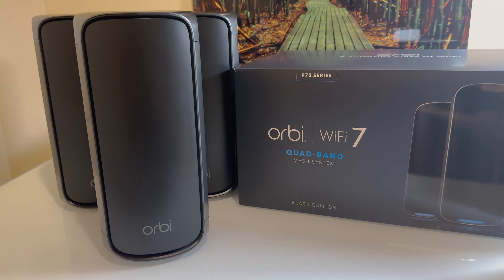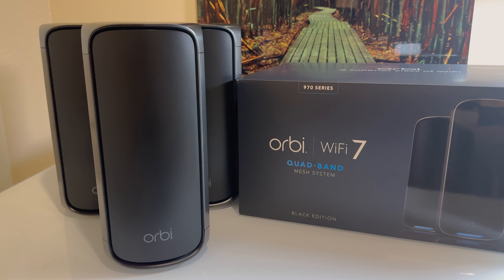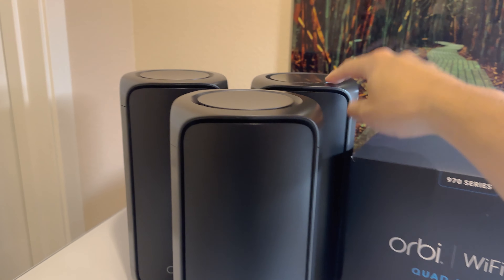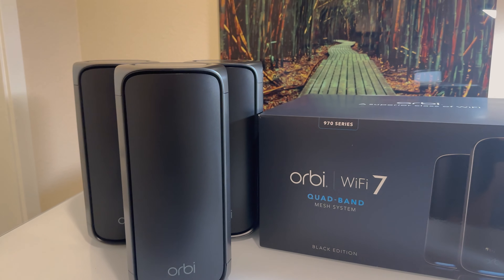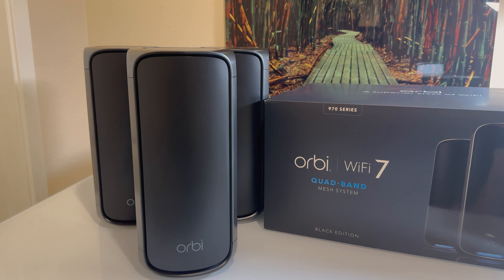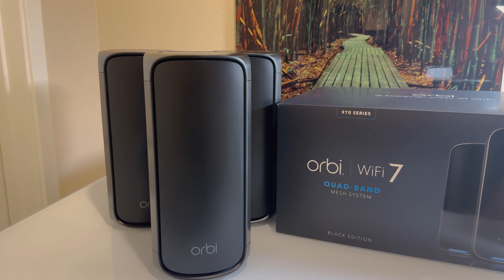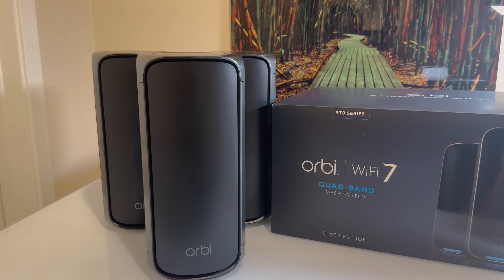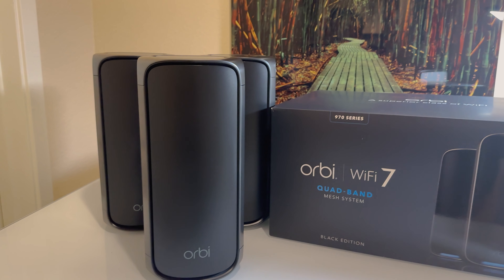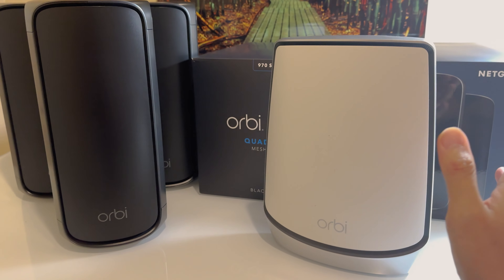The main question a lot of people are going to have is: why did you even bother upgrading to Wi-Fi 7 if we don't even have Wi-Fi 7 devices? Well, the main benefit from upgrading to Wi-Fi 7 for the Orbi mesh system is wireless backhaul — meaning how the router is talking to the different satellites. In our household, we have multiple media centers and computing areas, and our house is not entirely wired by Ethernet. Wireless has largely been able to carry that through a wireless backhaul.